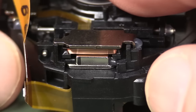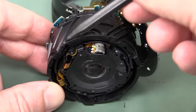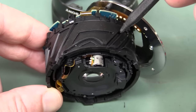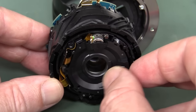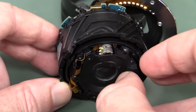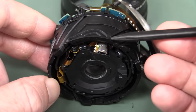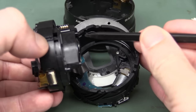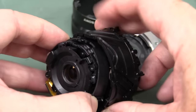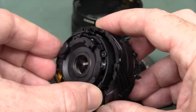They've obviously got a multi-turn coil inside there — maybe 20 or 30 turns — and that is good enough to actually position this thing. In addition to the zoom guide mechanism out here, you can see how the pin can go in there and ride that slot — back and then forward and then back again in that particular pattern. And there's also one on the inside as well, just to allow it — yep, it just rotates that. There's a similar but not as complex guide on the inner side in the ring, snaking its way around in there.